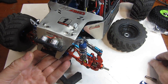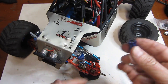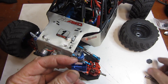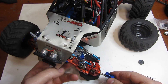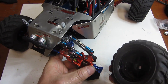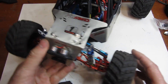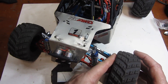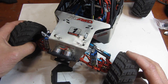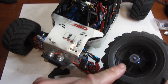I'm going to take this piece off and show you exactly how this works. This is a hub extender. I'll put my little jack stand under here — you have the same little slots each way. This is 20 millimeters long as opposed to the stock adapter being about 5 millimeters, and obviously it's going to extend the wheel out as the name implies. It will engage into that pin as well, and as you can see once I put the wheel on, it sets it way out from the tie rod, from the steering rod. Now I have plenty of clearance, and if I turn it I have plenty of clearance between it and the body. That's the main reason you would want a hub extender.